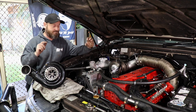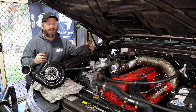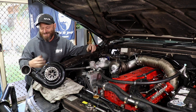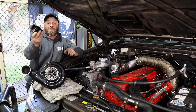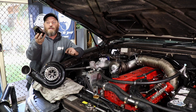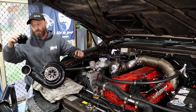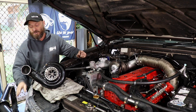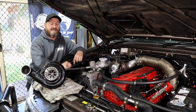And then we're going to jump under the car and address the gearbox mount issue. It's got a sort of solid gearbox mount at the moment — it's very noisy and vibratey, albeit obviously break-proof. So we're going to change it to some rubber mounts. These are actually original patrol gearbox mounts, so there's two of them. They're not going to work in the original format, but we're going to fabricate some bracketry and sit them on that and see how it goes. Let's get stuck into it.